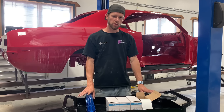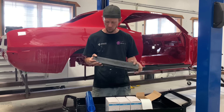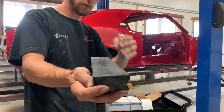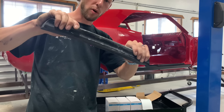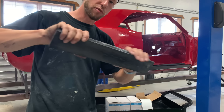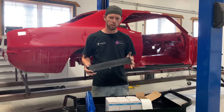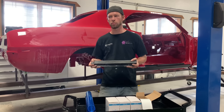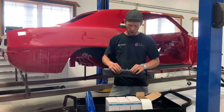Let's go over some of the main differences between these blocks. This block is made of a rubber foam composite type material. If you look down this block, it's not very flat — it's kind of cut this way and bowed this way, and it will form to the shape of the panel somewhat. There's really no backbone to this type of block where it will distribute pressure evenly. A lot of times it'll put the pressure right where your hands are.